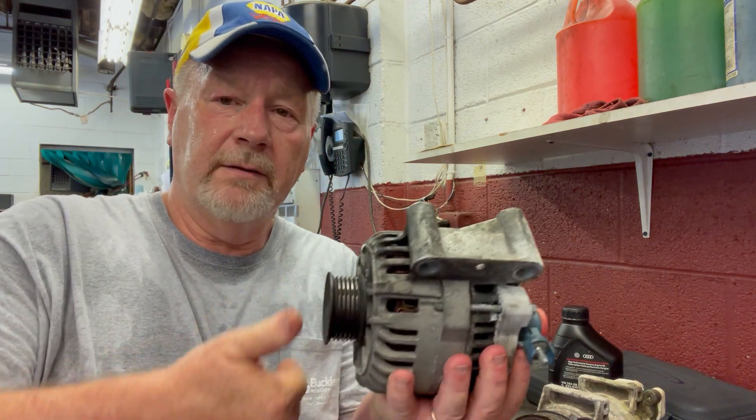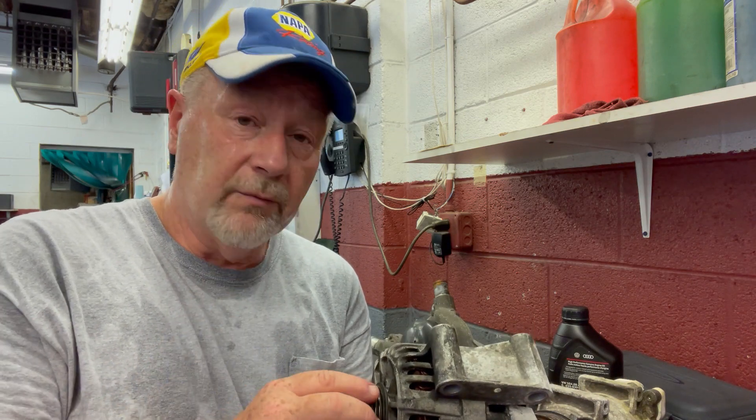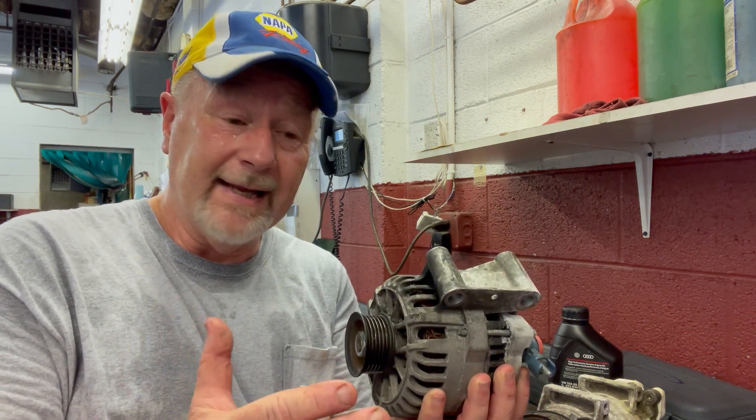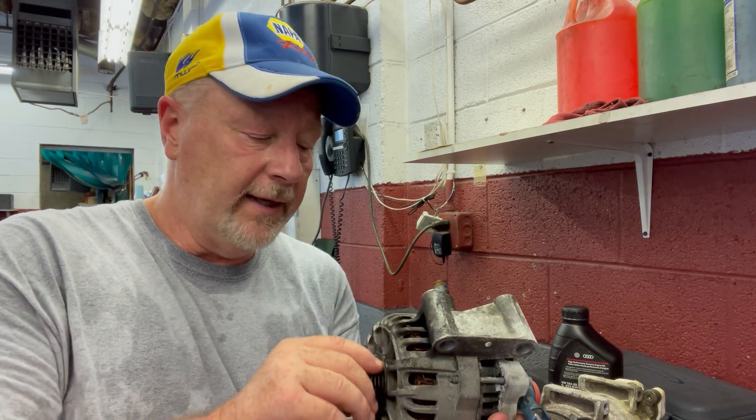In order to keep these units functioning as properly as we possibly can, any kind of air restriction — airflow across the engine and through the engine bay compartment — is very critical to the performance and longevity of these units. Let's start with the alternator. It rotates and will eventually wear out. You can't predict when or how, but you can do your best to maintain it. For the alternator, the best thing you can do is keep a good long-life battery — keep it charged. After four years, replace it even though it may say five or six years — don't go to the max. As that battery is depleting, the alternator has to continue charging and replenishing it, working harder. When it's not working hard, it can just freely spin.